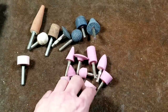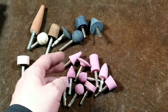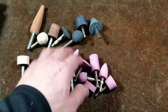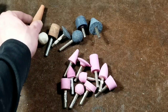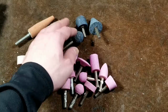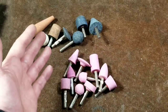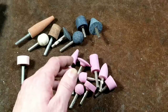These 10 pink wheels actually came from True Value. They don't have part numbers, but they have UPC codes, so I'll include those. The others are just kind of general. They also come in orange. I'm not entirely sure about all the differences in grinding material, but they are primarily aluminum oxide; you can also get silicon carbide and some various other grinding materials.